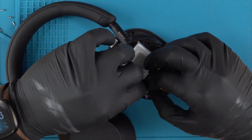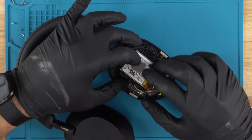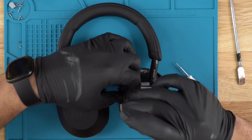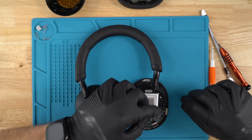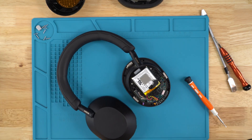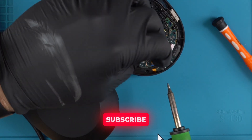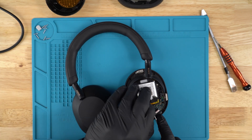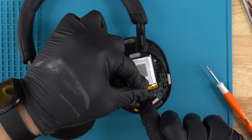Once you've done that, go ahead and reinstall the cover — pull the speaker wire through and push down on the cover so that it adheres to the adhesive. Once that is complete, plug the main internal wire back in, get back underneath, and fasten the small silver screws. Once the screws are fastened, notch the speaker wire in and go ahead and solder it back on. If you don't have schematics, blue goes right there and copper goes right next to it. Now plug the battery back in, and I like to put this film or tape strip back over to hold everything together so it looks factory.